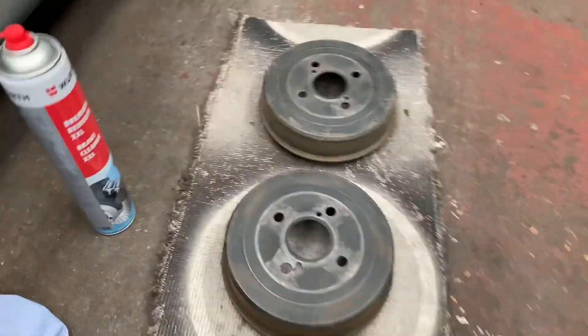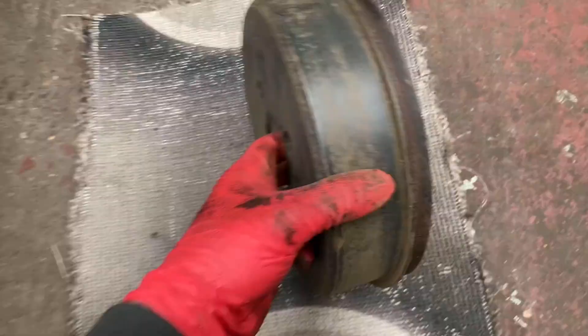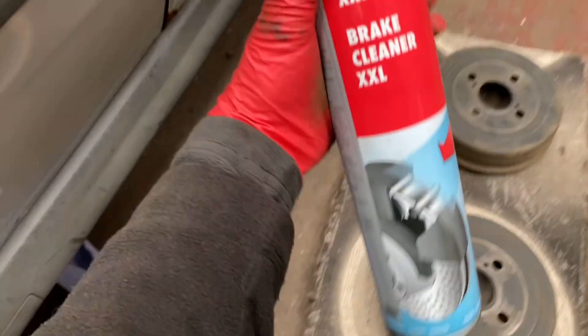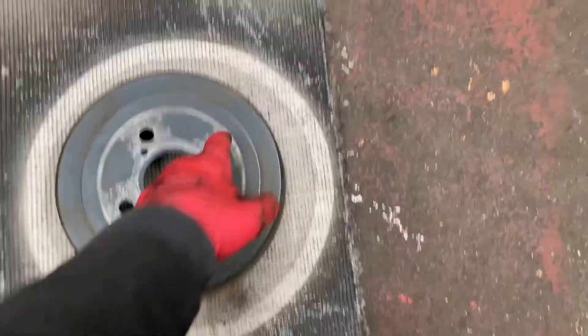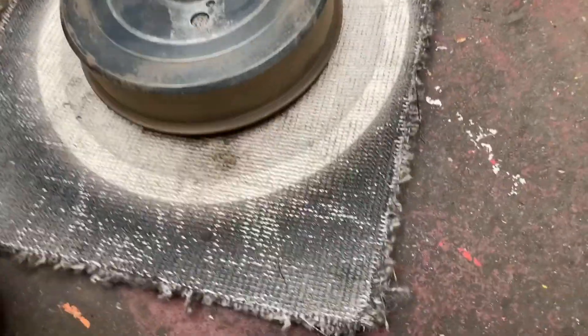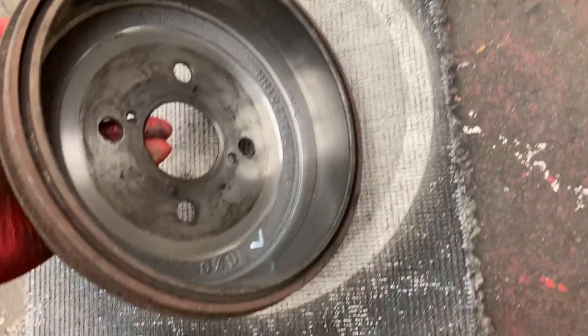Right, so welcome back. I've just given them a gentle scrub down with some fine sandpaper, just to give them a good key. So next up, a bit of solvent — get yourself some brake cleaner. It's fantastic. Obviously you want to clean the inside of this area up before you fit them, in case any contaminants get in. But keep the brake drums down like this — you do not want to be getting any paint inside of there, or grease, because that's your braking surface area. Don't get anything in there.